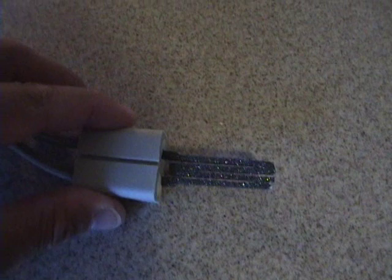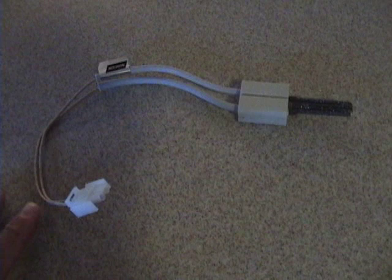One of the things I'll tell you is that these igniters are very delicate. As I was pulling it out, it hit the ground and shattered, so we've got to be real careful putting this new one in. The igniter got warm but it just didn't — it glowed, just not hot enough to turn the gas on and light. So we're going to stick this baby in now.